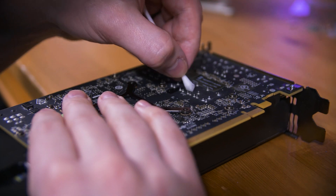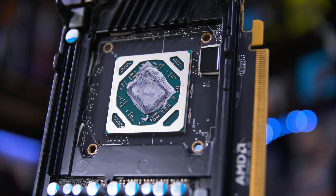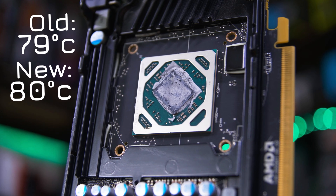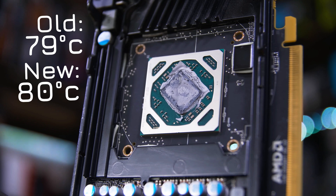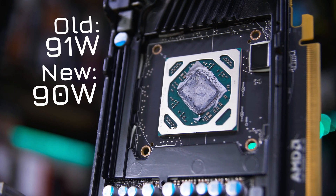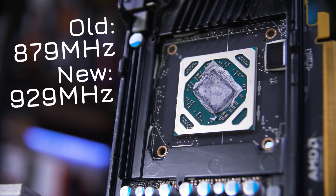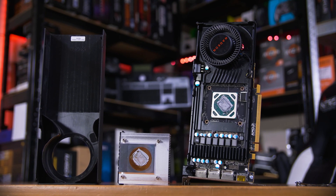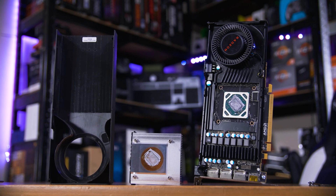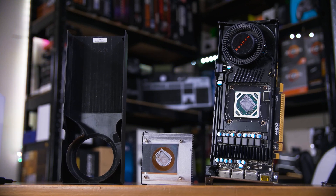To see if the repaste was actually a success I ran Furmark before and after and got some interesting results. The average fps was the same — about 64 fps both times — and at first glance the temperatures were actually slightly higher on the repasted card, which doesn't sound like good news. But digging a little deeper shows the cause: the fan was running about 200 RPM slower, the GPU die was drawing about a watt less power, and more importantly the GPU clock was running about 50 MHz higher, so it's running more efficiently. Considering the only real issue was some crusty thermal paste, the slight improvements are a pleasant surprise — and it's certainly something I'd recommend on older or dirtier cards.